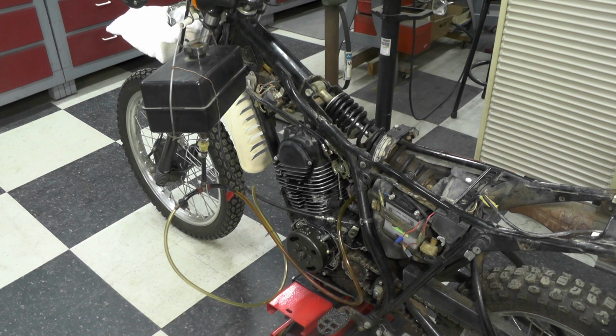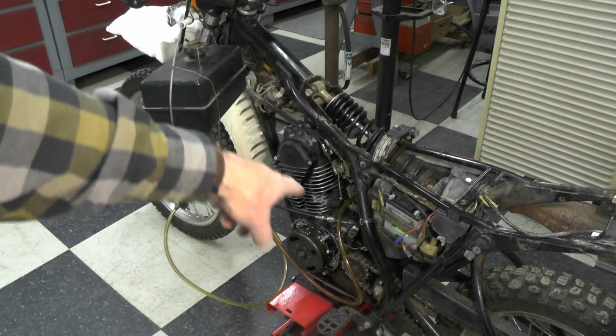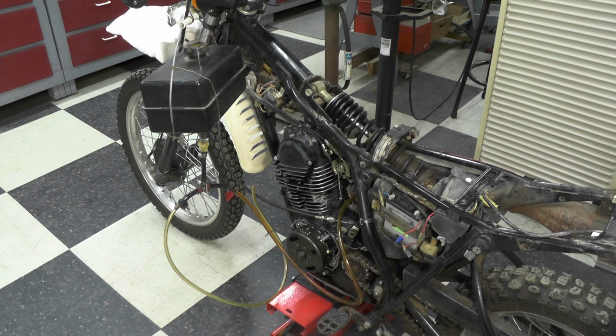There were no leaks. So I thought, normally I would have expected it to be leaking out of the overflow, which means fuel would be coming out underneath the bike, because typically the overflow drains down past the swing arm. And I do recall, I might have mentioned in a previous video, the carburetor body was all full of fuel. That whole area around the carburetor was all full of fuel and contamination of fuel and oil. So, oil meaning from being dirty and residue on the outside of the carburetor. There's no oil in the fuel. And I thought, that's most curious, because if the float needle valve was sticking open and it was overflowing out the overflow tube, it would again come out of the bottom underneath the bike. This didn't leak at all.